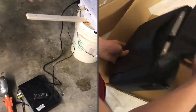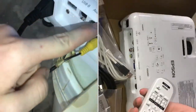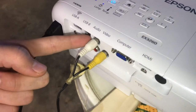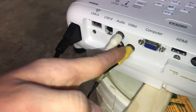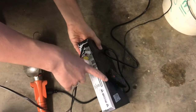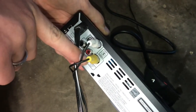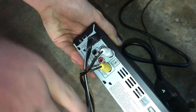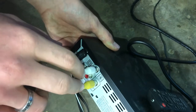It was very simple to set this whole thing up. On the back of the projector there are two different rows: audio and video. On the audio row there's a white plug and a red plug, and in the video row there's a yellow plug. On the back of the DVD player we have a white cord and a yellow cord coming out. We don't have the red audio out and you don't need to hook that up — you rarely would ever use that.